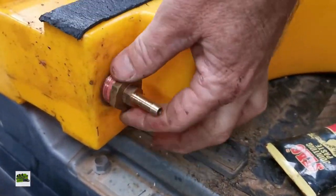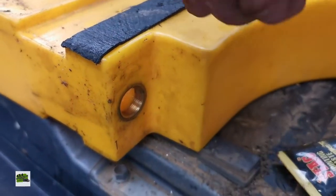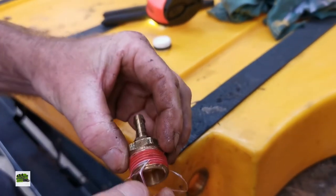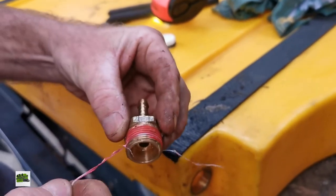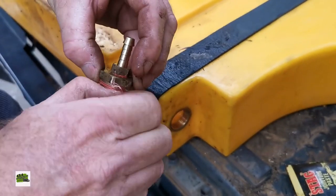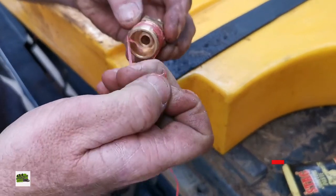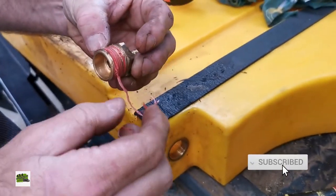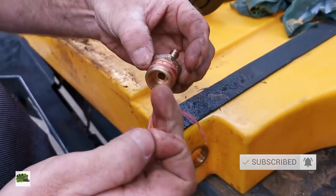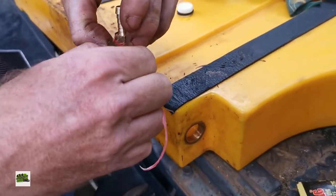We reckon what went wrong was that ages ago when I assembled this plumbing, I used water thread tape for the fuel system, which is wrong. So we are going to do it once and do it right — take all the plumbing out and put the correct sealant back on. It's not really a tape, it's a thread sealant liquid. So we went to our local auto store and got something appropriate to put it back on. Hopefully it doesn't happen again.